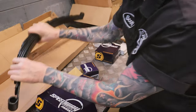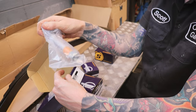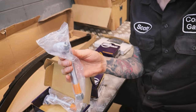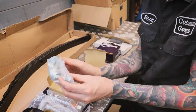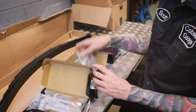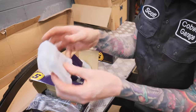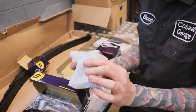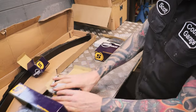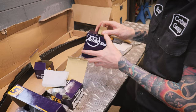The reverse eyes will drop the front end a little bit, about an inch or so. All these bits came from Speedway in the States - really good value for money, obviously a bit of shipping to the UK. To mount the spring above the axle, I've got these spring perches, which replace the ones in there at the moment. The bottom part has a bracket so you can mount a shock absorber. In here are the shackles, and that's all for a one and three quarter inch spring.